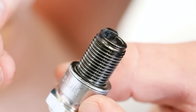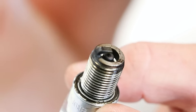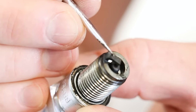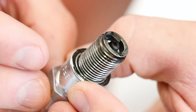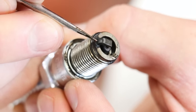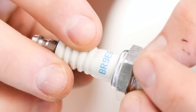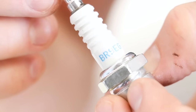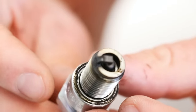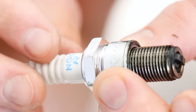The very last thing to read on this spark plug is the heat range, which we check at the tip. If the plating is burnt on the end of the tip, that means the spark plug is too cold for the bike; if it's burnt at the base, the spark plug is too hot. Ideally it should be burnt right at the bend of the tip. On this plug, if anything it looks like it's burnt more towards the base, which would mean this plug is too hot. On NGK spark plugs, the number in the code — like BR9EG, the '9' — indicates a colder plug; 8 is standard and 7 is hotter.